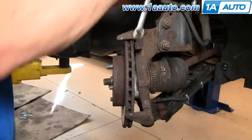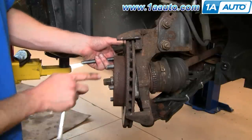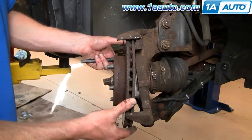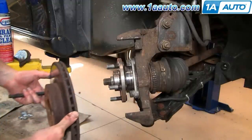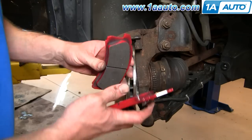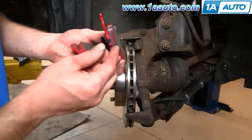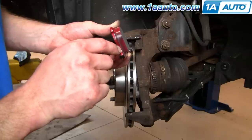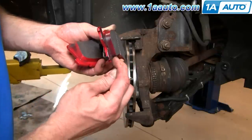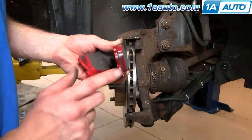On most cars these days the disc just pulls right off, though on some cars it may be held on with a nut and cotter pin. Here's our new disc from 1A Auto — it goes on just like the original. And here are our new pads from 1A Auto. You'll notice a little tab right here, roughly lined up just inside of the metal. That tab is a wear indicator. Once the pads wear down, that tab will start hitting against the rotor and make that squeaking noise you sometimes hear.